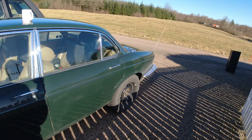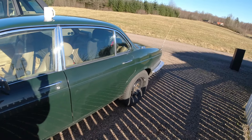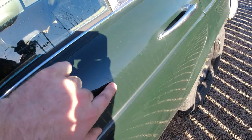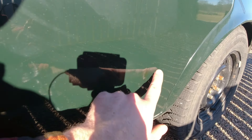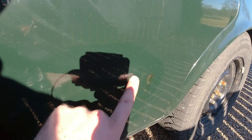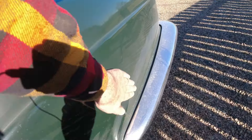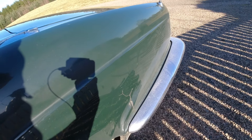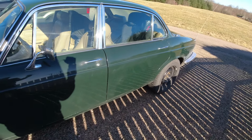It's on this side — the car has been painted many times on both sides. This is just a chip where someone has hit the door. However, this here is also a chip and it's a little bit loose. I'd like to just use a small sandblasting unit around there and fix it, because that's probably just a little bit of bondo or spray filler, which was really common in the 90s. The same thing on the back looks a lot worse, but that's just cracking. So I want to fix that up as well — I'll paint the rear wing. That rear door is fine and that's really the only thing that's happened in all that time. I think that's not bad at all.